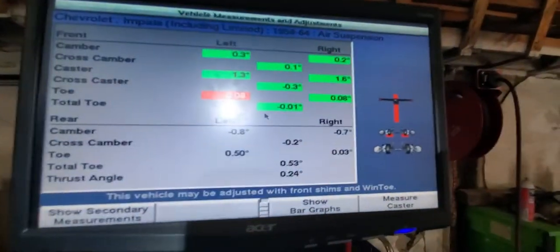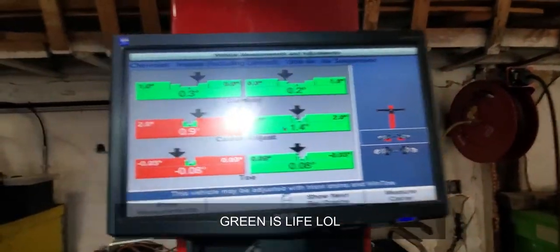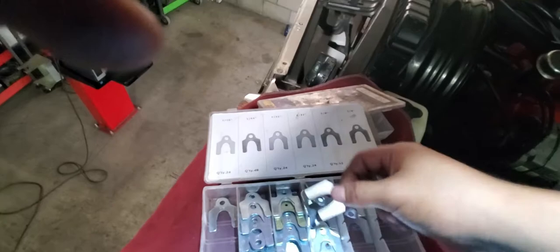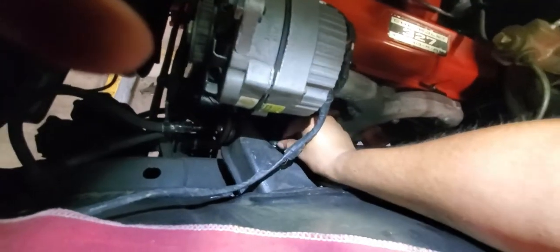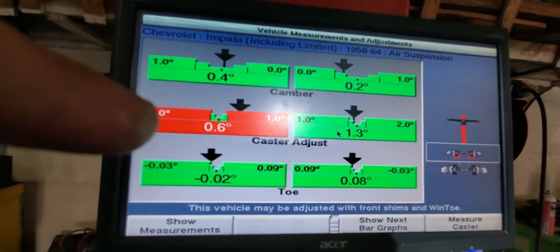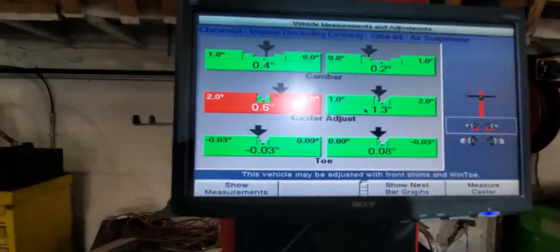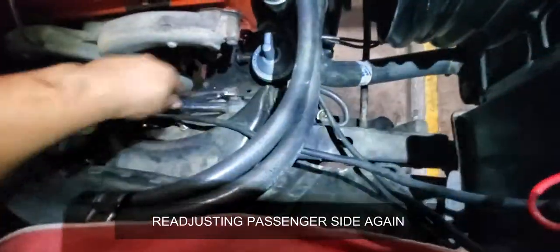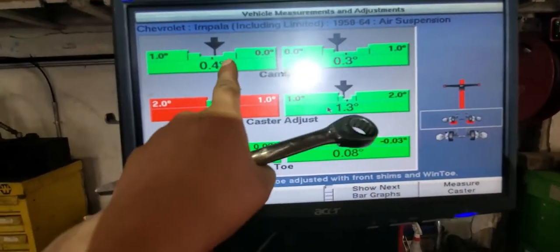You can see it's becoming more green. I went a little bit too far, but the measurements are closer now. Caster is never accurate unless you do the measurement — so every time you move it, you have to remeasure caster. Both sides are the same process — we're back for the third time.